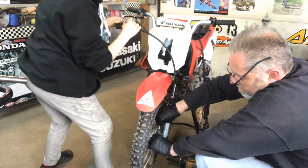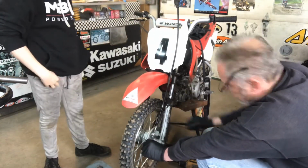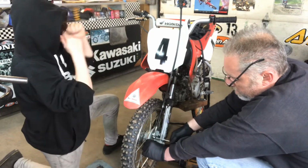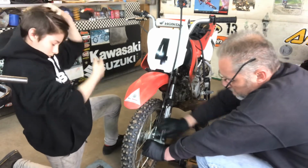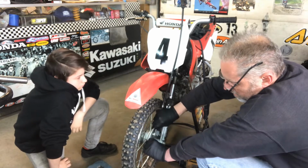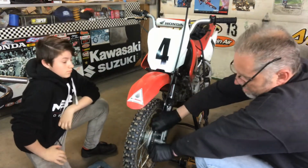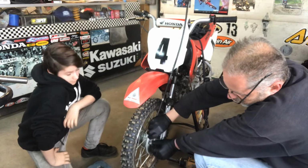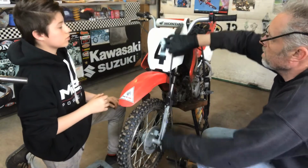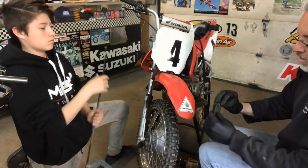It looks a little twisted, the cable. Well, it's all good. So once I remove this lower nut on the adjustment, then I'll be able to remove the cable from the backing plate. So just pull on the cable, lift it through the backing plate. Remove the cable from the brake arm. Remove the little cover for the lever.